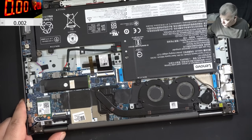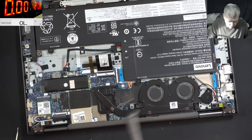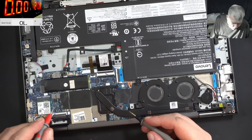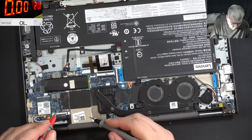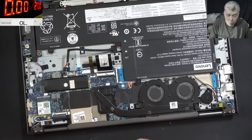I don't think a frozen EC chip can cause this kind of behavior, so before we move forward let's check the main power rail to see if it's shorted. We have a bunch of capacitors here - no short, it's just ground. So the main power rail is not shorted.